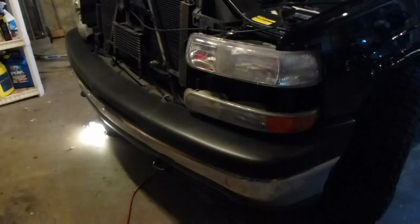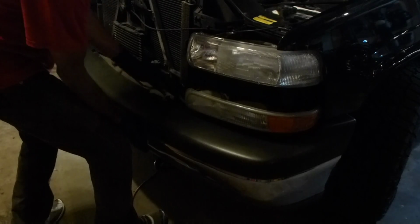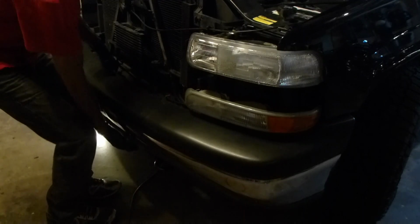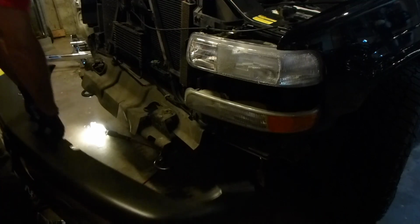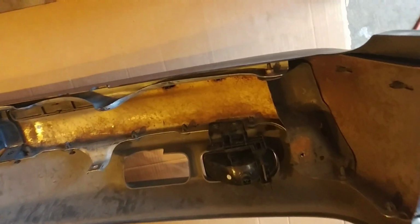And then the left side stabilizer, you can see bolts to the bracket on the bumper. So I've got all those off. The bumper right now is just barely hanging on the 2 top bolts, which I can easily pull out. They're already unscrewed. I'm going to pull those off, set them aside, and you can see now the bumper just kind of pulls away from the vehicle. So let's put it aside and get to work on disassembling everything.